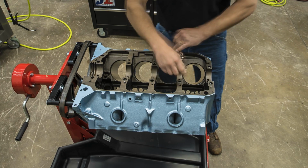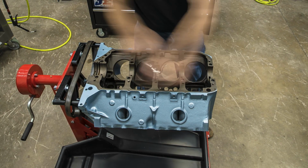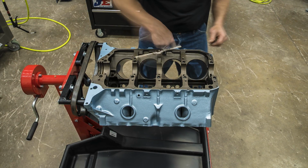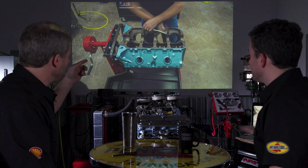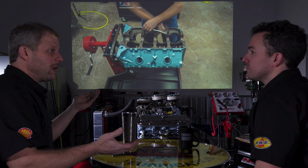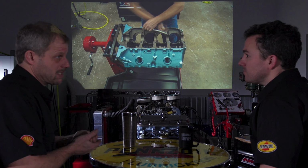So when they decided, hey, my clamp load needs to be X amount and it takes this amount of torque, they're also saying it has a constant mu of the surface, so the friction is a constant between the two. So the point is, a rusted-up thread and a smooth thread, you might torque it down to the same number, but your clamp load will not be the same.